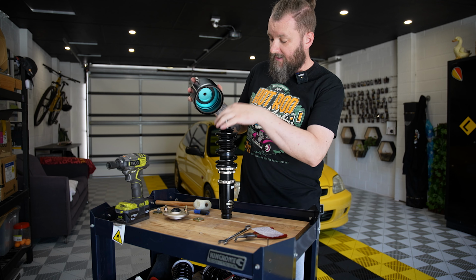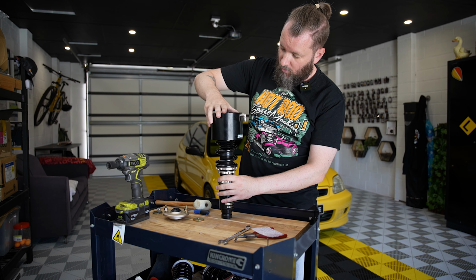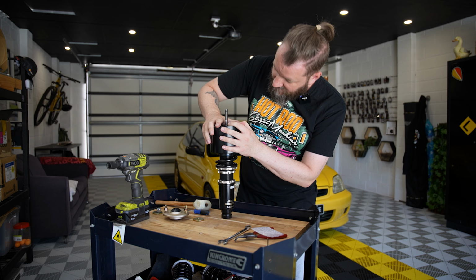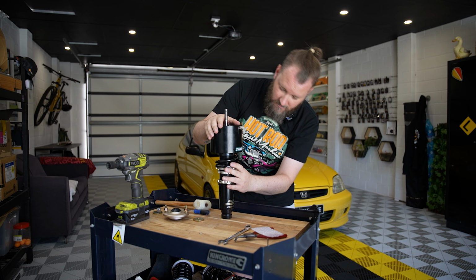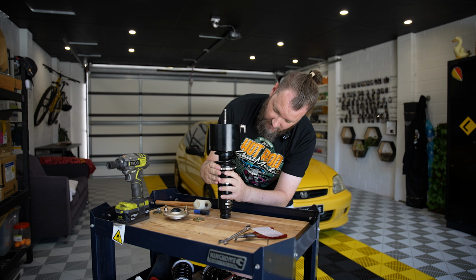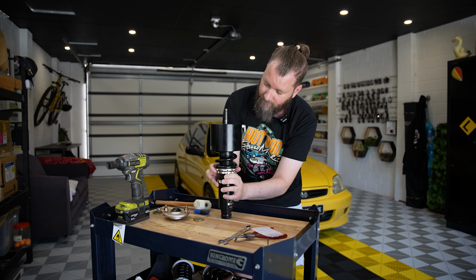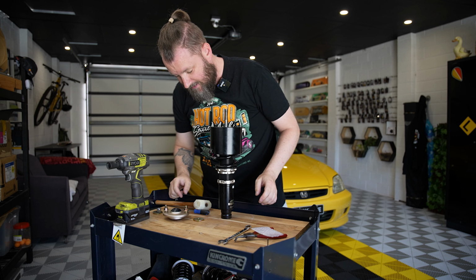Okay. All right, so washer, spring, put this on. Orientation right now doesn't really matter, so you're good. So you're gonna slide that on nice and gently. Then you're gonna go just past where the circlip would go. So you actually need a bit more space here. Release a bit of the tension. So wind that down just a little bit more. Like that. All right, so we are now down past the little circlip.